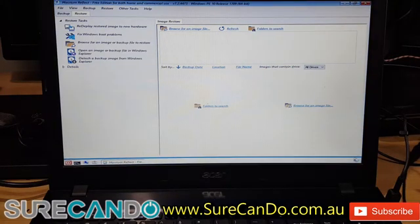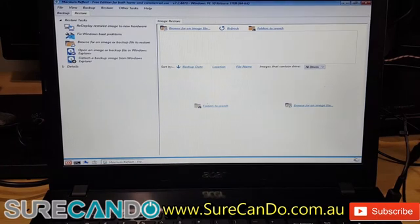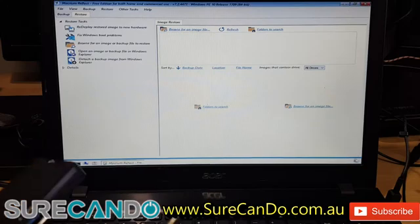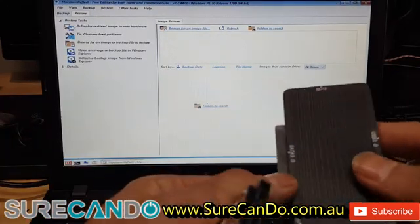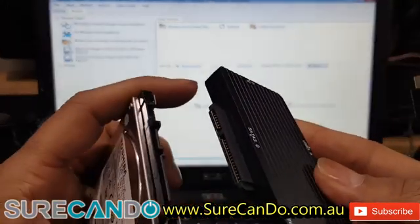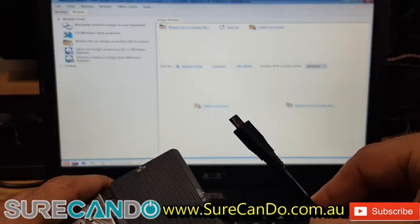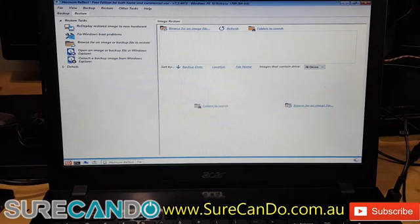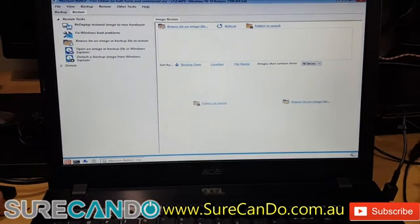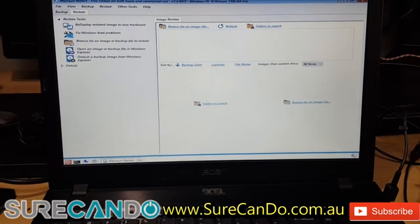That's it. Normally, I will use a USB to SATA converter. This laptop has Type-C, so I'm going to utilize it. It's much quicker than USB 3.0. So what we're going to do is we're going to use this adapter here, SATA 3.0 for the hard drive, and the Type-C cable straight into the laptop, and it should get detected. Let's see what happens. I'll plug it in. Very curious. Let's see. Let's go.